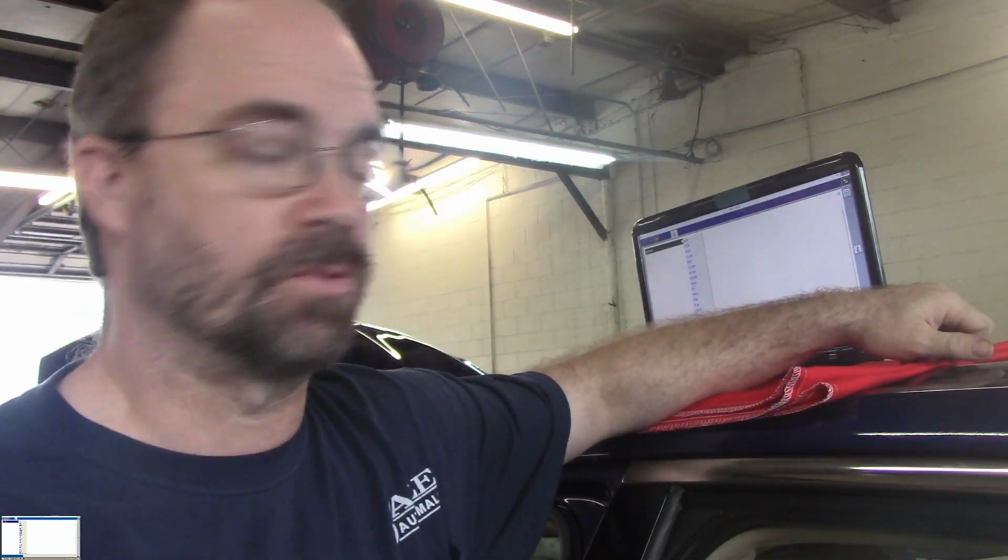You're supposed to do what they call an inhale exhale procedure, provided the module you have works. If it doesn't, you got to go through a whole different scenario, which is what we got to do now, because I did not take the information out of the old gear. So you go through this procedure, and you take the information out, put a new module in, or gear in this case, and put it right back in.